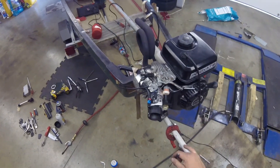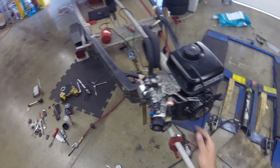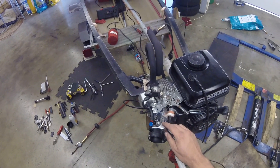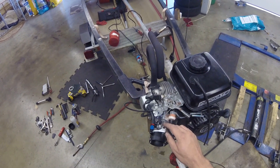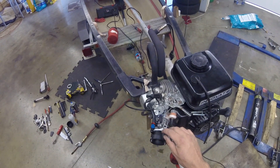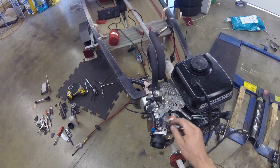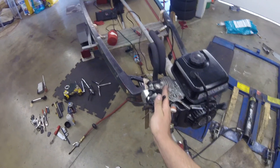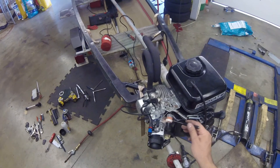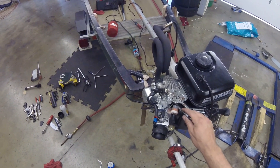This isn't a super simple straight bolt-on carb swap, but if you can handle the linkage that'll save you work. I made my own lever, welded it on, and ground it until I had the right idle speed set point and a perfectly wide-open throttle position with the blade at 90 degrees. I also tied in the little fuel filter that came with it.